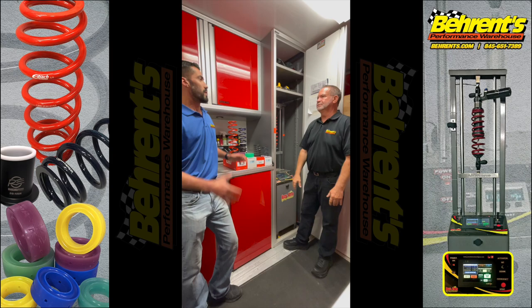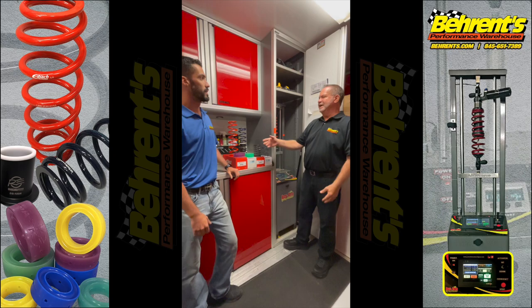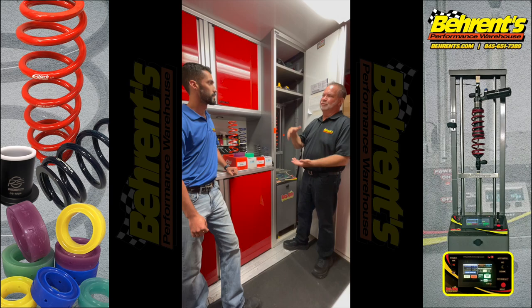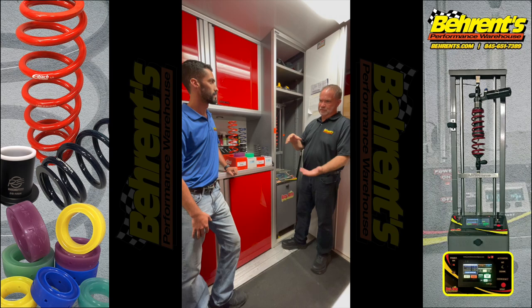That's all we hear on the coil spring conversation — load. So what is the big difference between rate versus load? Rate is what the spring is built and rated at. Like this one here is a 150, so that spring is 150 all the way through travel. Load is where you pick a static load number, which is where your car sits at ride height on your scale before you're ready to go on the racetrack — it's static. So that 150 spring, if it's compressed two inches, has 300 pounds of load. That's very simple to figure out. If it's a 200 pound spring compressed two inches, it's 400 pounds of load — that doesn't make it a 400 pound spring, it's the amount of load. So when we look at working on a spring smashing machine, when you compress that thing to four inches of travel on the right front of like a big block modified, you're gaining load as you go. It doesn't matter what rate spring you have — it's the final load number that guys are concerned about.